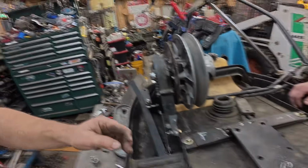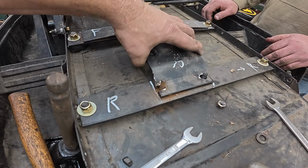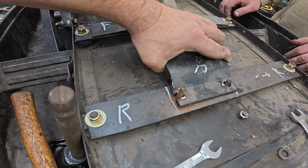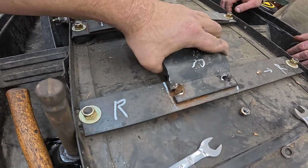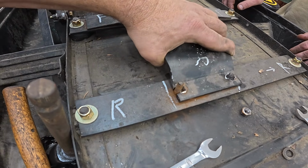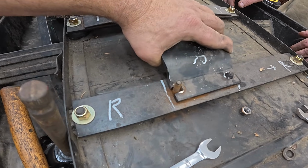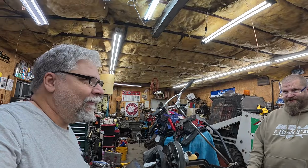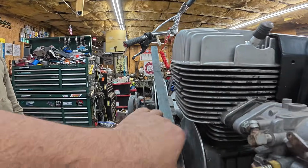Motor mount butchery complete. It's only 26 horsepower, but it's now fully adjustable, and we can get a good little quarter inch. We can go side to side, and we can do a little bit about the parallelism, and we'll just use the washers we need to use. We ought to be able to get it aligned. What do you think? It'll be good enough. It's got to go 20 miles. Only 20 miles. That's all the longer the Wild Bill is. All smiles. Greg, you even got a smile. Check out this engine alignment.